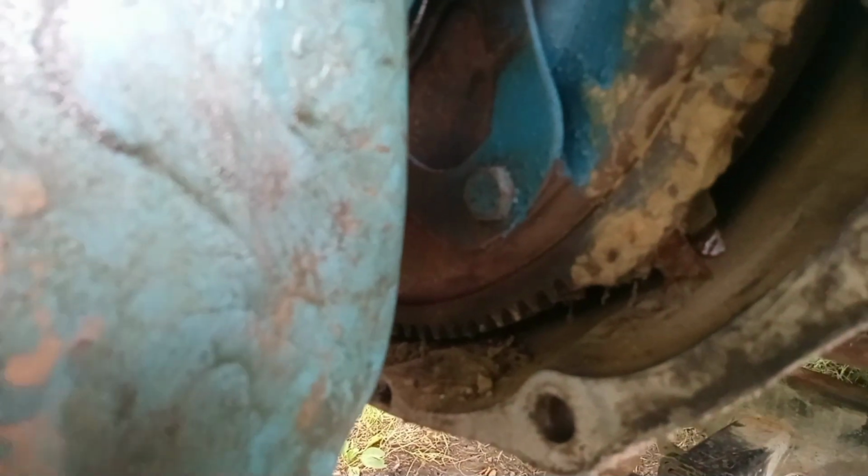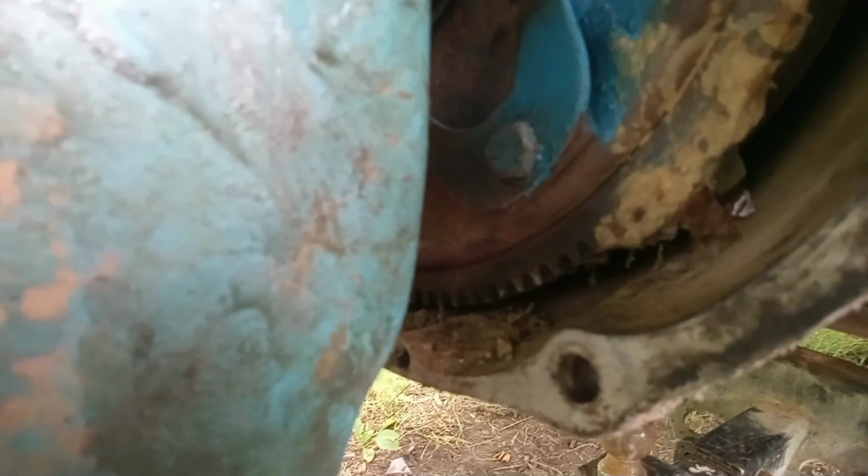All right, guys, here's my mark. There's my converter. We are all done. I just did the old hammer torque on them while I held the crank and did the best I could. It's honestly a two-person job, but I did okay. Now, because there's not a lot of room down here and everything, I'm going to go ahead and put the inspection cover and stuff on, and I'll bring y'all back when we get ready and move the truck over here, and we're getting ready to put this bad boy in.